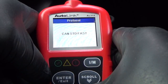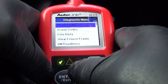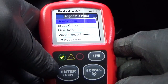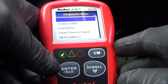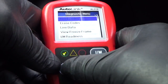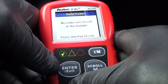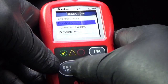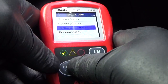The car is on. I press Enter and you can see the checkmark turns on immediately — that means the car is ready for a state inspection. If the triangle light turns on, it means somebody was in there and erased codes. If the red light turns on, you've got a DTC stored in memory. Since there are no codes, I select Read Codes and no codes are stored in the module.